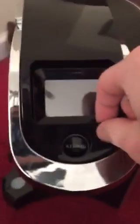Easy — just follow my directions here, should be done in about 10 minutes. I already started a little bit to make the video shorter. What you need to do is take off this whole top piece. Open the top lid, there's a screw right there and right there. Just take those two screws out, this should come loose. Then take a flathead screwdriver and come out back here, and that will pop it up, and this whole thing will come off.